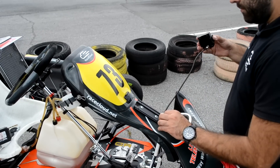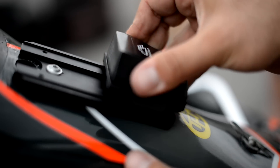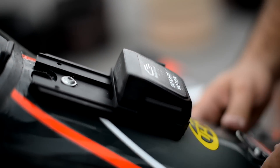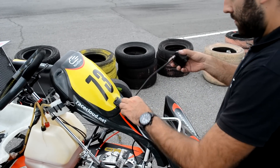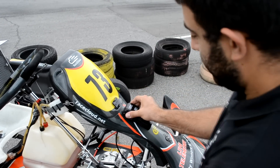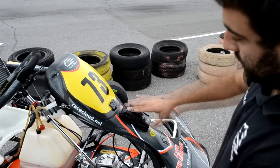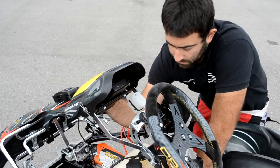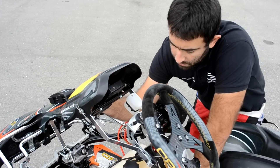Clip the go-kart motion and connect modules onto the plate and insert the cables under the nose. Check the secure fit. Keep in mind that the motion module should be in front of the connect module and facing the direction of travel in order to assure correct telemetry operation. Now plug the motion and connect cables into the box's connecting ports — any port is okay and you don't need to worry about plugging it wrong. After inserting the cables into the connectors, twist the cap at the end of the cable to ensure the best possible fix.